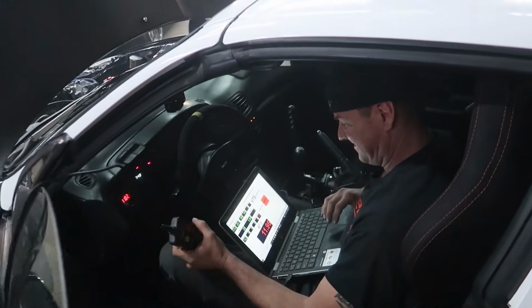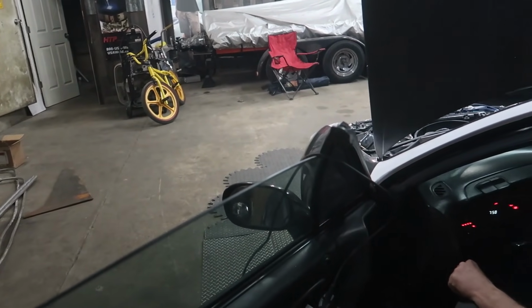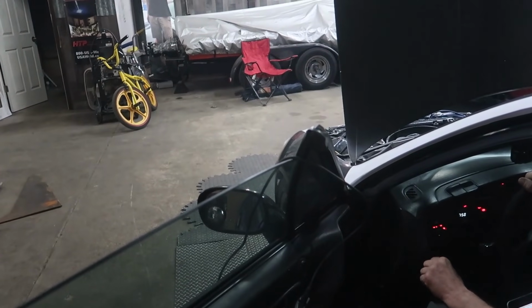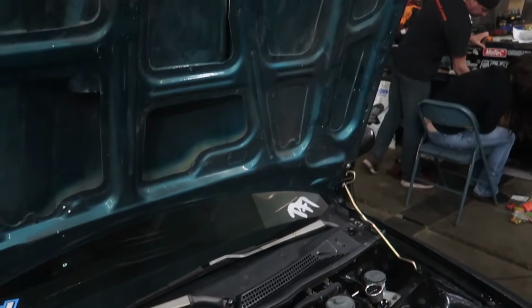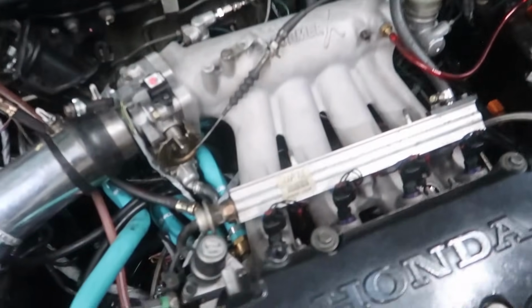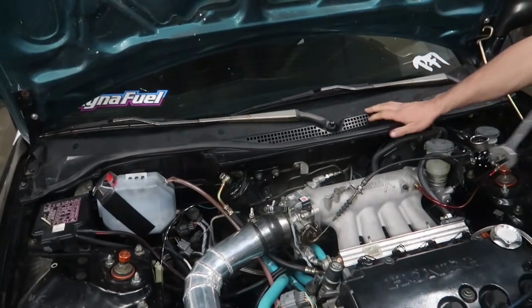Saw how much that thing was glowing. And it was glowing good. That was the worst. You should see it. So either the regulator's not rising, or it's got a low pressure pump, or yeah, there's not enough pump. Because I'm at 97, 98% and 1,000, so in theory I should be good to 500 at least. Yeah. Looks like the thin ones. Yeah. So Brent's got a fuel problem. We're at what, like 97% duty cycle? Yeah. So we're gonna check and see if it has a spider washer real quick. We're waiting to hear back from him on what pump is in it.